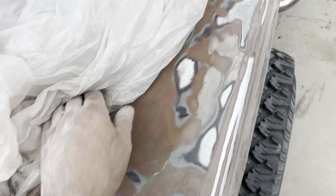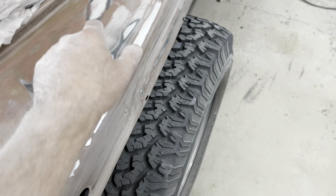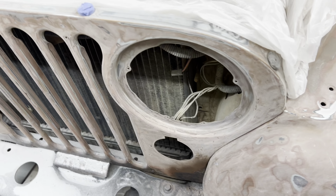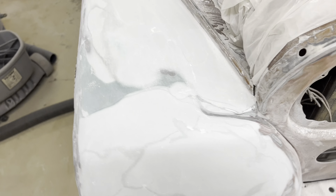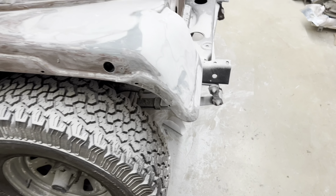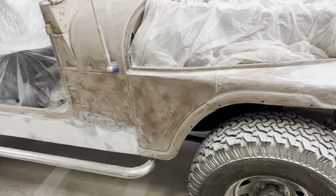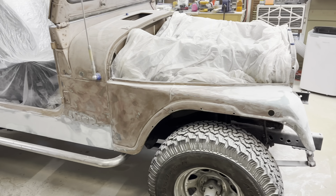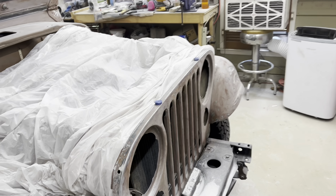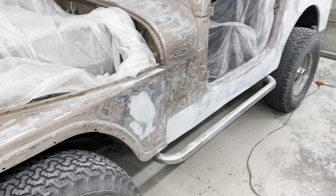These are areas that when Allison sanded the fender for me — she did 120 and then 220 — these are just some areas where she came up with some bare metal. It's part of the process, it's just what happens. So I've got areas all over it that are going to need the self-etching primer. Once I get this sanded to 220, I'm going to blow it off, open up the garage door, blow the garage out, spray the self-etching primer, and then let it sit at least overnight. I may even wait until Wednesday to do the 2K primer on the body. All right, here we go.